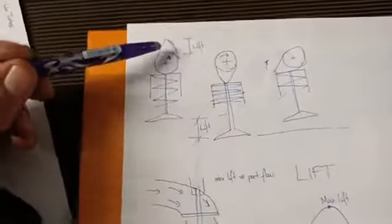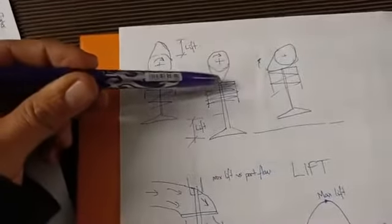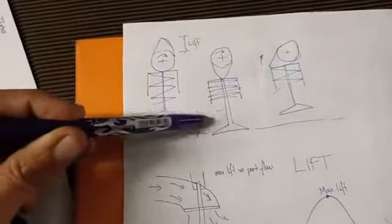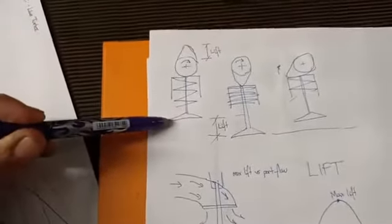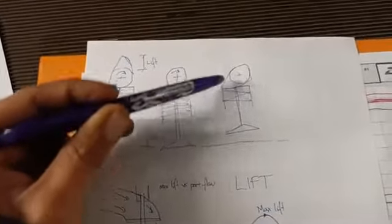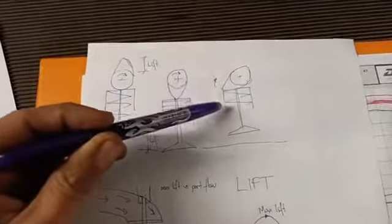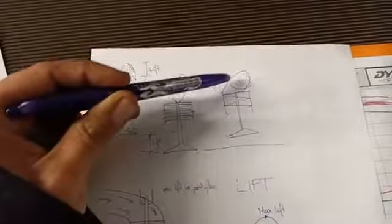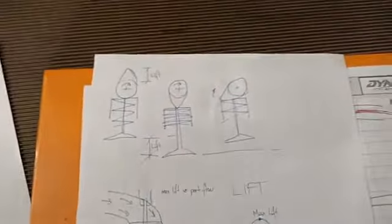Coming into this view here, my cam has rotated through about 180 degrees. Now you can see the nose of the cam is actually pushing on the bucket. In here my spring's compressed, so my valve's actually further down compared to this one. My cam's rotating this way, and let's assume that it's rotated a little bit more. Now the valve's starting to close, so you can see the action of the valve and how it follows the camshaft. This is our follower, which follows the camshaft and the profile ground into this lobe, and we've got our valve spring. That's in a nutshell how it all operates.